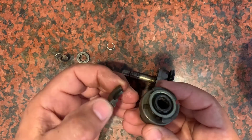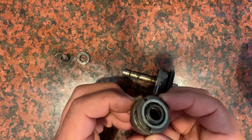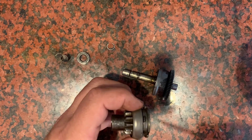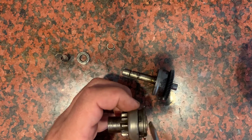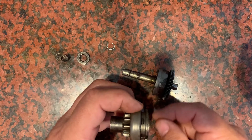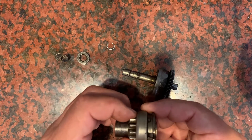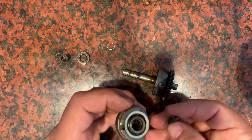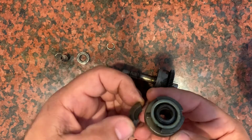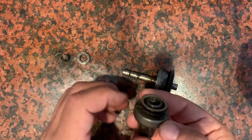These things come right out, and I have another video clip of a different Bendix that has this spring still — there is a spring that rides right along in here the whole way around. It's just a round spring, very very fine and tiny, and they rust and they disintegrate and they're gone. I guess they're not totally required for the thing to work, but probably in the best scenario if that spring's there, it might help with the momentum. But these three pieces you can just take right out — it's helpful for cleaning and wire brushing.